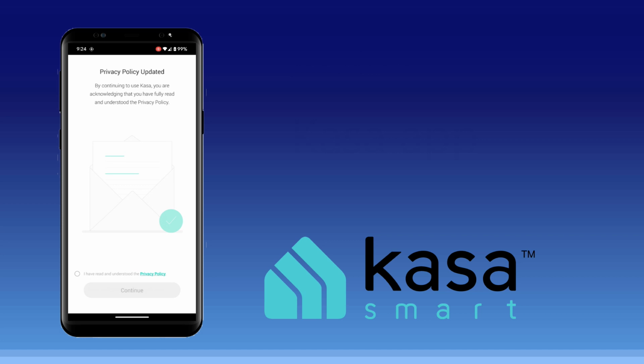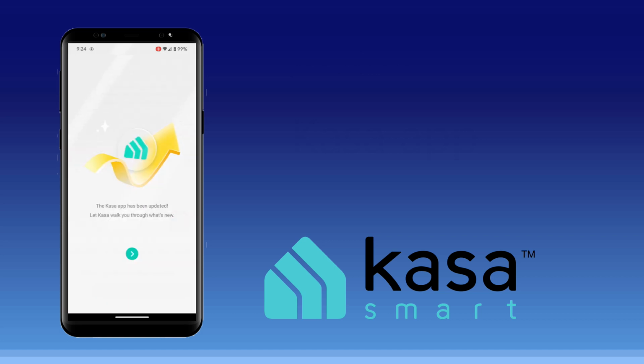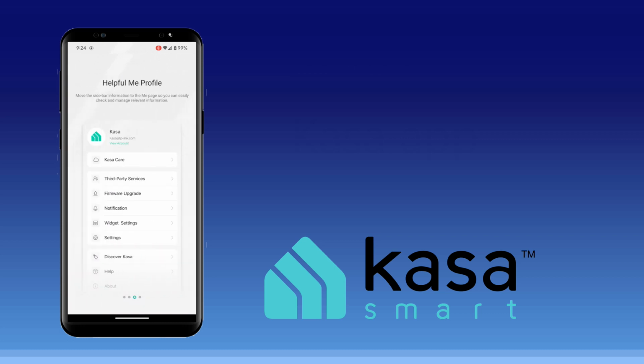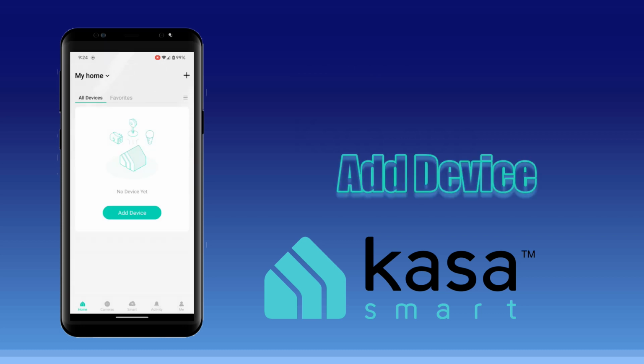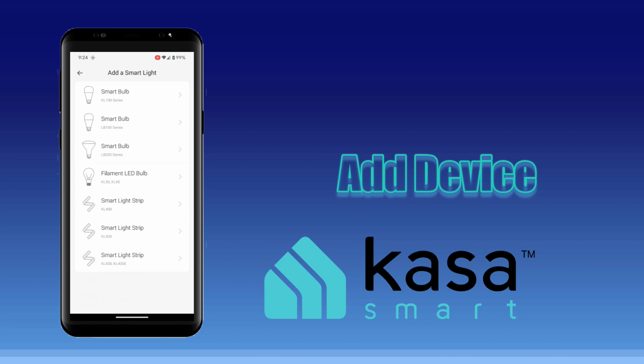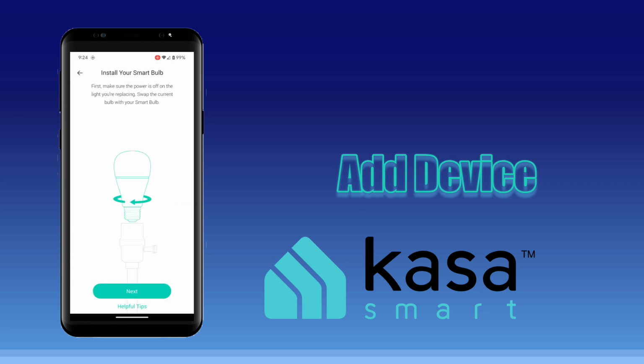Next, read and accept the privacy policy, then continue. Depending on your situation, you may get some informational screens. For now, just step through them to reach the main screen. At this point, we can add a new device, which in our case will be the Kasa Multicolor Smart Bulb. Select the plus sign at the top or the Add Device button. From the list, select the Smart Lights option. Select the Smart Bulb KL100 series or your series if you're using a different bulb.